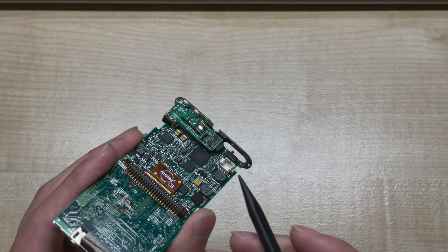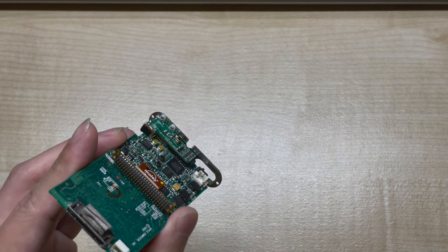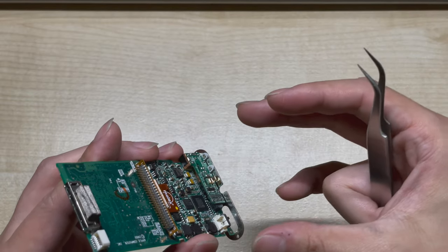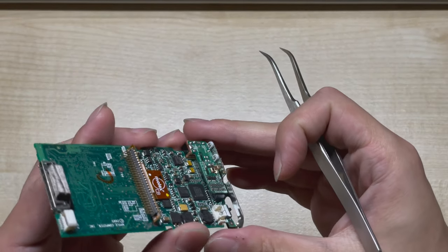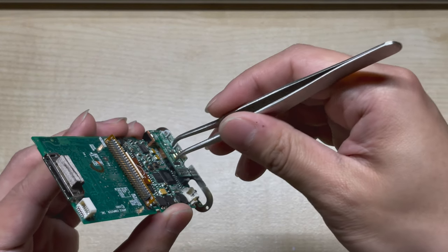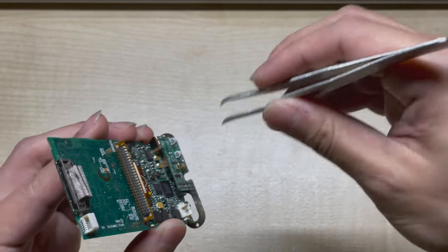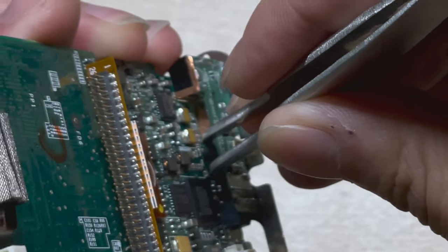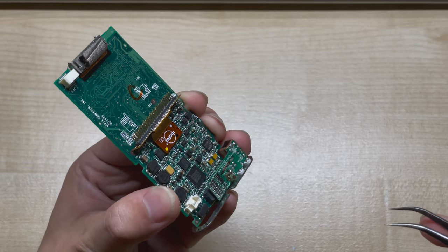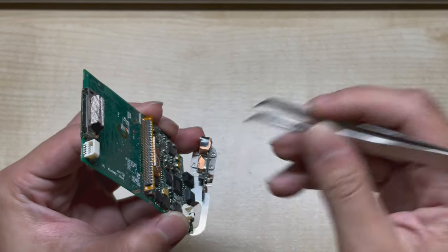The clicker speaker we'll be removing is actually located underneath this board here, so we're going to have to unplug it. Now this is quite a tricky part again, because one common mistake is people pull too hard and then that destroys the connection. So we're going to take a pair of tweezers and slide it into the connection between the plug and the socket, and just gently rock it until it comes out. Just take your time and don't rush. Eventually the connection will loosen enough that you can just pull and the board comes out.